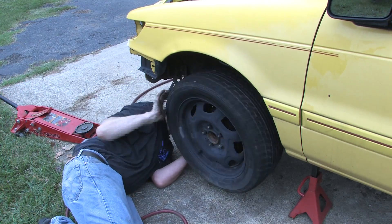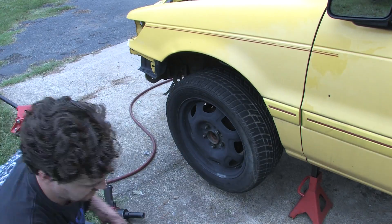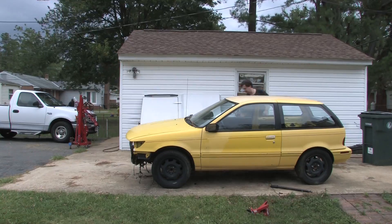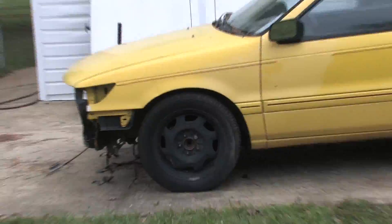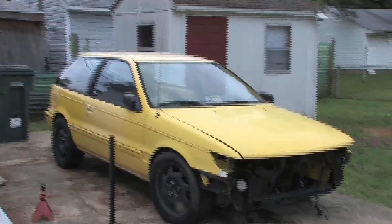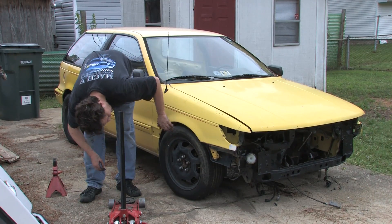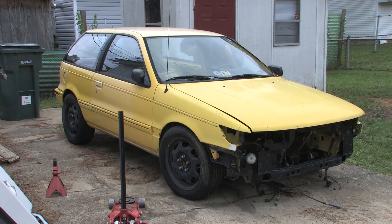At this point it needs camber correction and alignment, but for now I just want to see what this did to the ride height. There's about three degrees of positive camber, but I can easily fix that by modifying the strut mounts. It's extremely toed-in right now, but an alignment will fix that as well. There's just shy of a two-finger gap at the wheel well. I should get about a half inch more clearance once the camber and toe are corrected. These 195/55 16-inch tires I'm using for fitting are enormous in these little wheel wells.